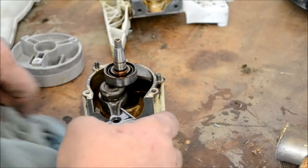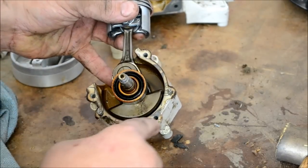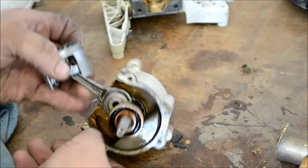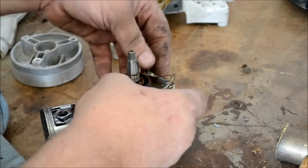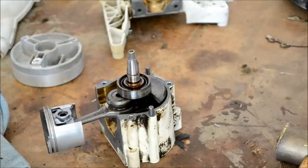And here's one of your seals that we'll be replacing. Unwrap your piston, and as you can tell, here's the other gasket that we will be replacing as well. This gasket was probably okay, but I'm just going to cover my bases and replace it. Here it is — chunk it, it's trash now. Let's go ahead and finish removing the crankshaft completely all the way through.